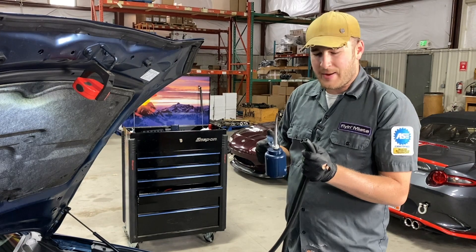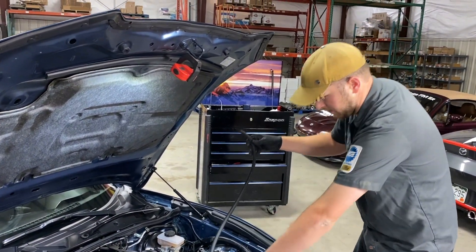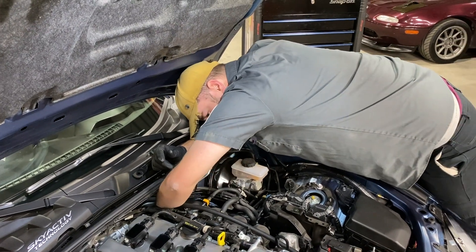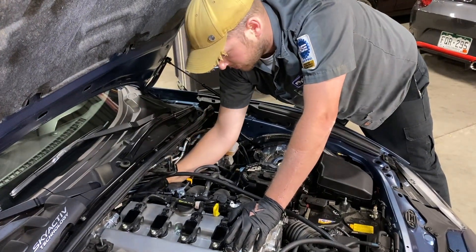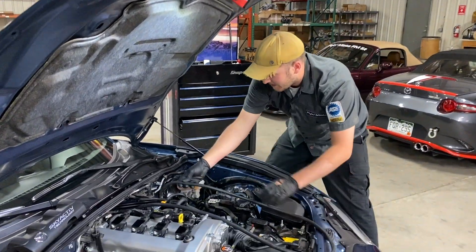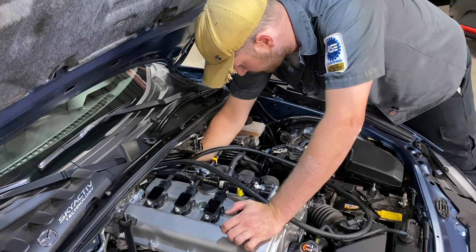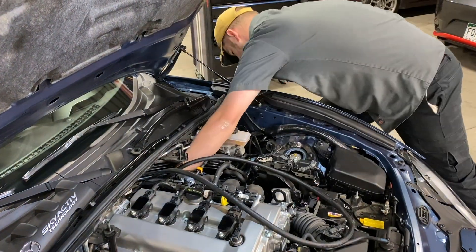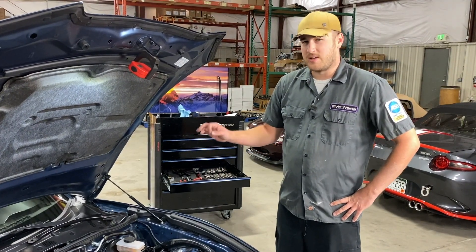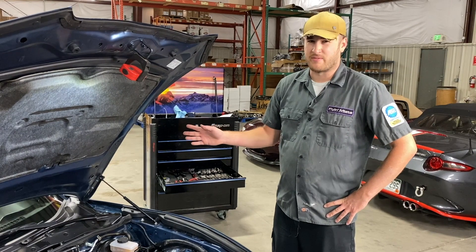Now, to make this go on a little easier, I'm going to add just a single drop of motor oil to each hose end. That is on the PCV portion. Now take the other end and try again to get it down onto that lower nipple. We finally got both ends of our hose onto the PCV valve and on the bottom of the intake. You've probably noticed — if you have a friend with skinny arms, it's a good idea to bribe them to do it. Maybe buy them their favorite beverage or something like that.